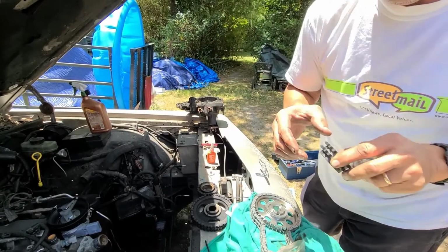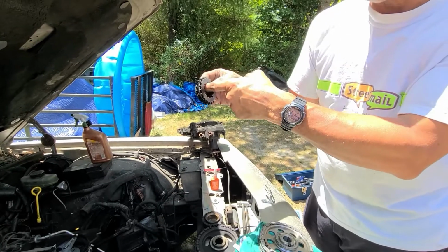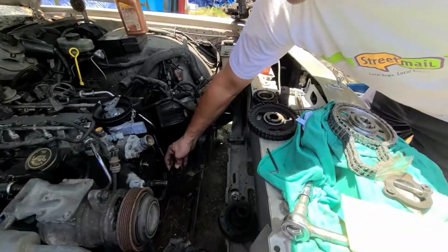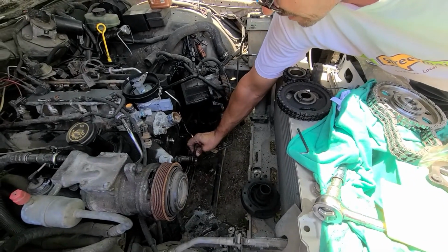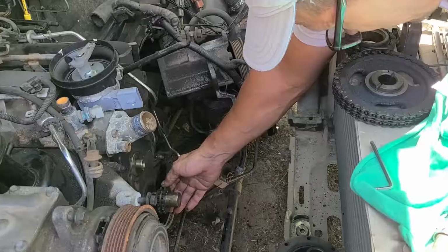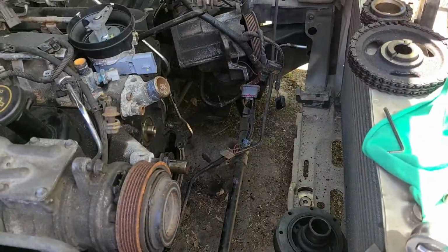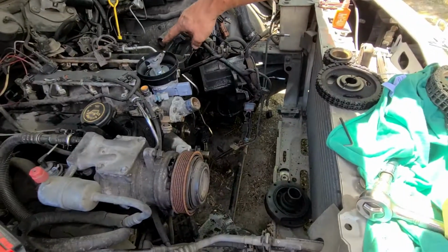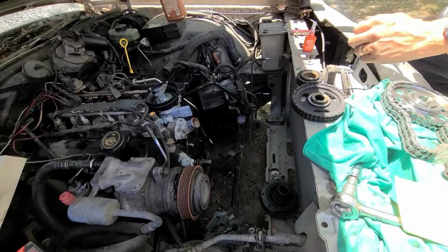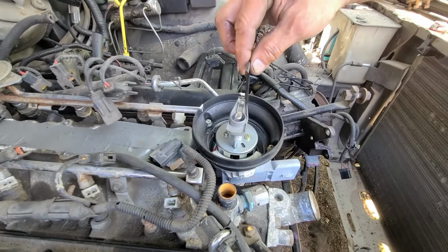Basically, I don't know what they call it, but it's just a shim cut into the end of the crank, and right there is 0 because I got it sitting on number 1. And you know you're at number 1 because the pointer is going to be pointing at the 1 o'clock or at the number 1, which is here on your distributor. Notice my problem.